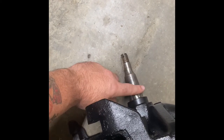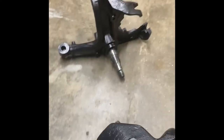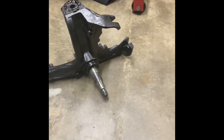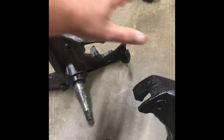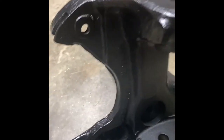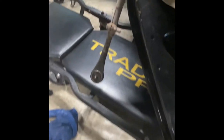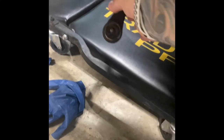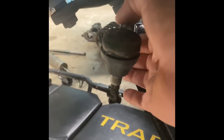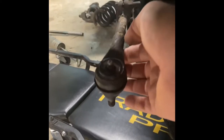The inch-and-a-quarter disc brakes are bigger, and the calipers won't interchange either — there's a bigger hole on one and a smaller hole on the other. The difference is they bolt up the same but have different gap sizes in the middle — one is wide open and the other has a cutout. The other issue I ran into is the steering tie rod: the old outer steering rod joint from the stock '67 to '72 isn't the right one either, so I had to order a new piece.